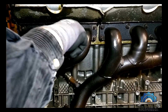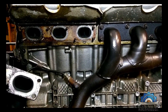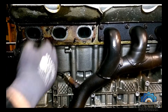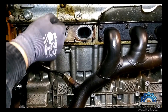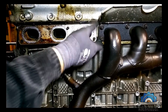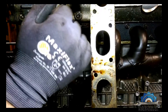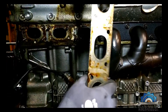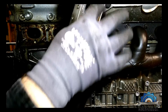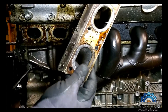The last bolt and last nut are coming off now. Everything is covered with oil because of the valve cover gasket leak. This is why you have to replace your heat shields and exhaust manifold gaskets every time — they have a special sealing compound around them, and once you remove them you damage the gasket, so there's no point reusing it.